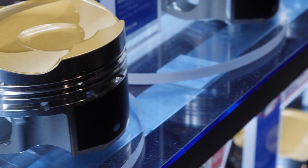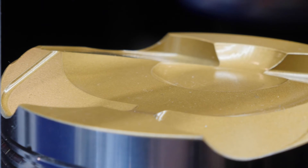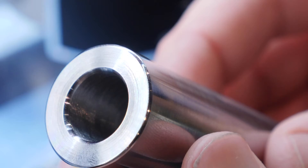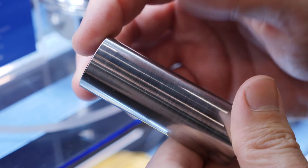In terms of these new pistons, the forging is about 20% stronger — are there any downsides in terms of weight? Pretty close to the same weight; depending on the application the design might be slightly different, but the skirt thickness and crown thicknesses are virtually the same — the strength increase is in the new process. The package also comes with premium heavier wall thickness wrist pins to handle more boost and more power, and they're also superior material — moving from a standard 5115 steel to 9310 steel, which has increased tensile strength.